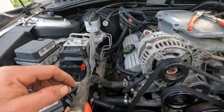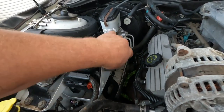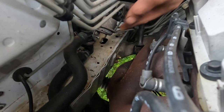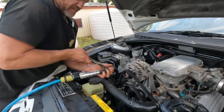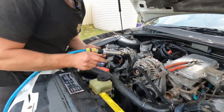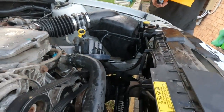One more thing I'm going to do before we connect it all back up is connect the flusher back to the heater core and give that a flush out. Because we haven't got the car turned on - it works off a little vacuum - I'm just going to push that tap into the open position. So we'll give the core a bit of a squirt out as well. I've just given the heater core that clean out and put the makeshift clamp back on. With all the hoses reconnected and clamped, we'll continue on.